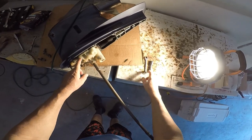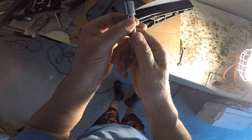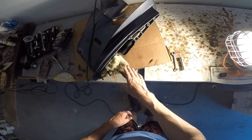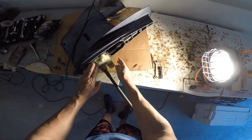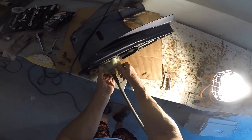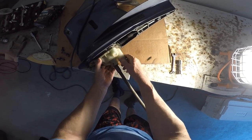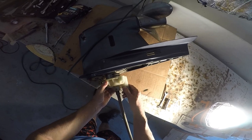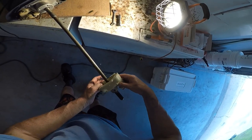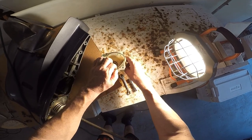I'm going to get a ratchet to get this off. All the bolts are out — this was a 12 millimeter or half inch. You want to mark the location if you're not sure; this face is the prop side. Wiggle the housing until it comes loose. Luckily our housing is good — we didn't burn it up.